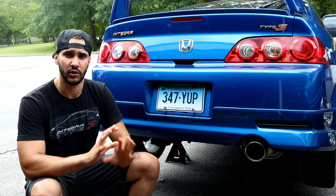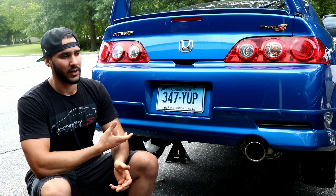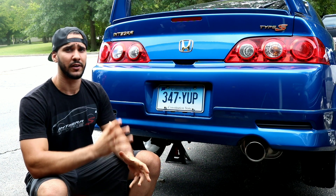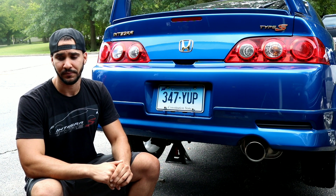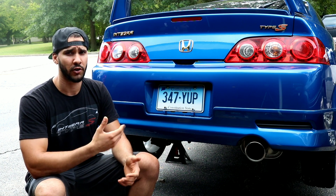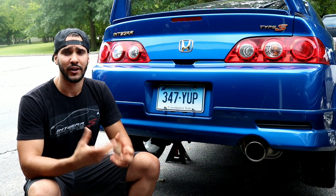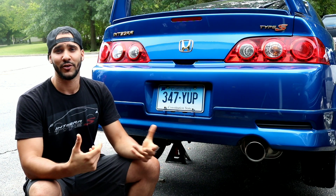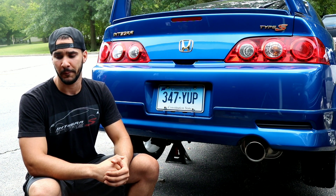I like keeping this car very clean, and underneath - the suspension and stuff - I really haven't touched that up too much, so today I'm gonna dive deeper into the suspension system. Another thing I'm gonna do is install a brand new part: a rear lower control arm. It's made out of aluminum, so it's gonna be a lot lighter, a lot stronger, and of course it's going to have brand new bushings, fixing the issue I noticed.